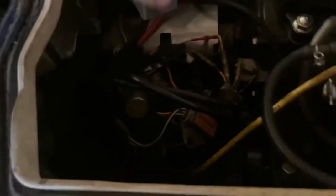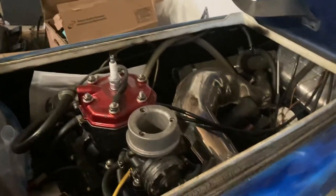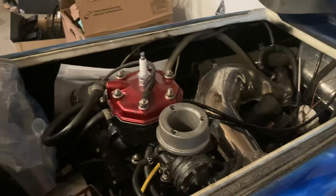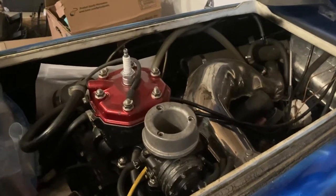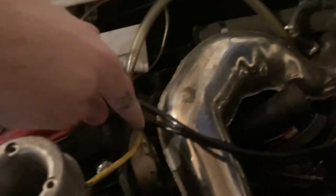I've got a lot of extra parts. The electrical box here — I've got different coils, different relays and electrical components. Basically enough to rebuild the box like three times. I've swapped out different configurations of parts to try to get it to spark, and it's very, very weak at best. So I'm pretty sure it's down here in the pickup.